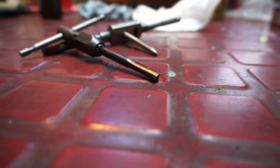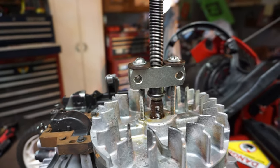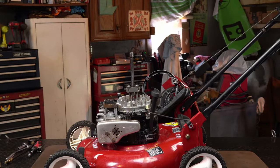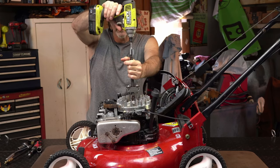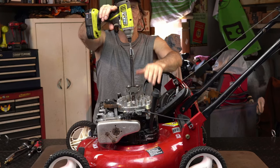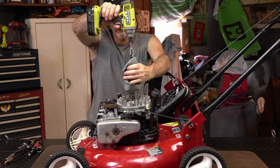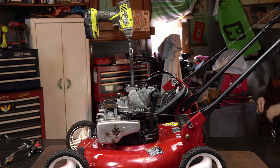Here's the setup - I have this conical thing on the end of this type of puller. Because we have a center pivot on the crankshaft, I can use this kind of puller. I have other pullers as well. You want to try to hold it straight. I'm coming from this side. Hopefully this will do it - a lot of times it does. If it stops I won't force it. If it stops - and it very often does because this is a lightweight Ryobi - I'll heat it and it'll pop. Put a rag on, go slow.